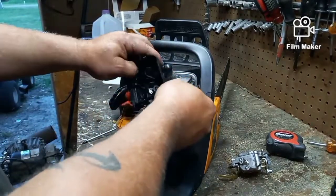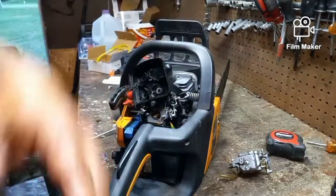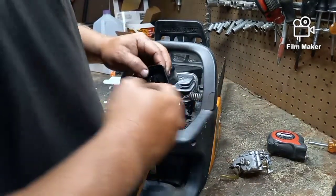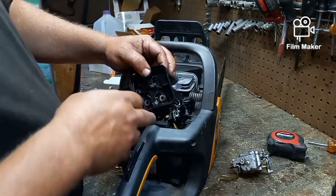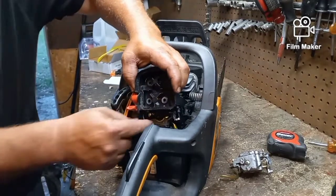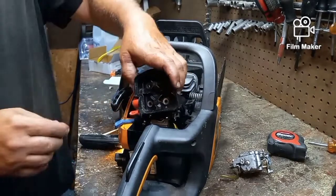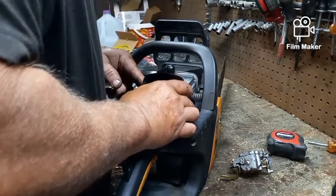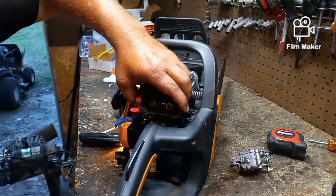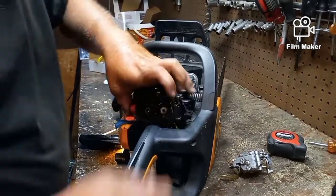The only thing left here is my throttle cable, which, if you remember, has to go back in there. Let me put that in there real quick. Okay, I put a new gasket on here. I matched the ones with the diagonals to the diagonals that were there. I put our throttle cable back in, and now it should be just a matter of feeding this thing back down, but without forcing it. And it feels like something is kind of holding it, and I'm not sure why.